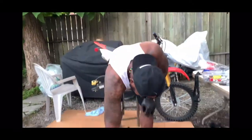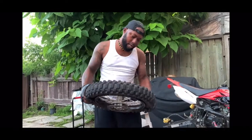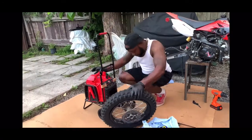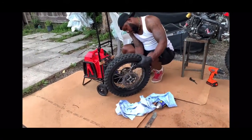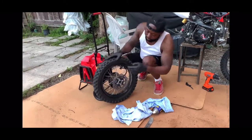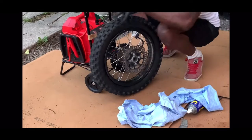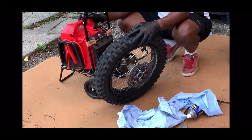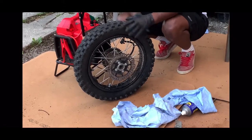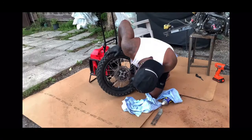I'm not gonna show you putting the tire back on the bike — I showed you how to install a rim lock. Let's put some air in it on camera and confirm that everything is okay. When you put air inside, you want to check to make sure that the rim lock part over here is seated properly on the rim — and so far so good.